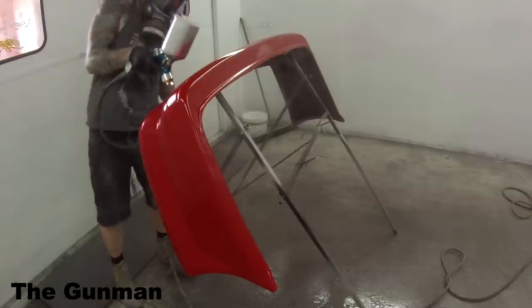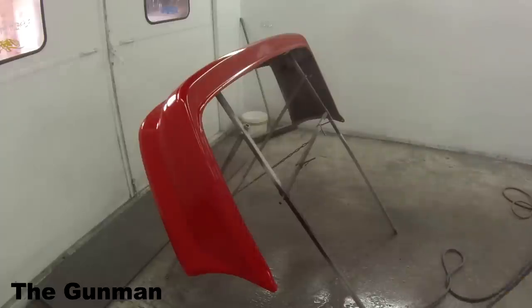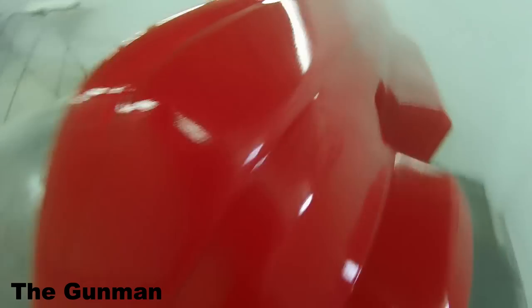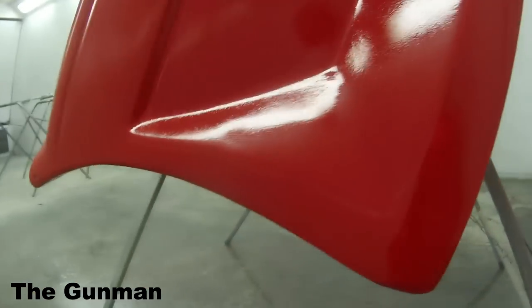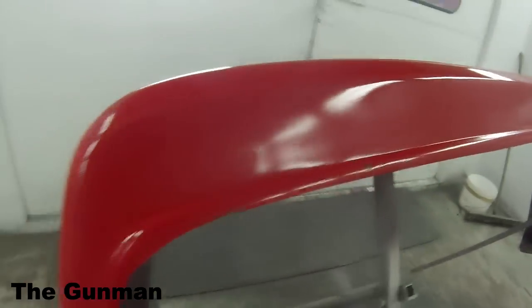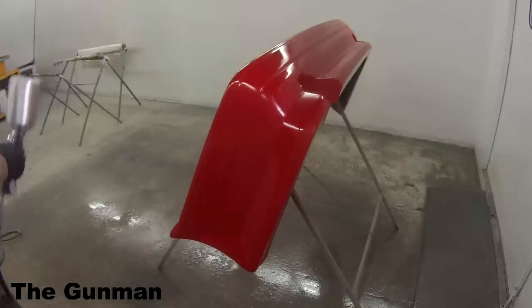The gun itself still has a little bit of a small fan on it. Those who saw the previous video — I wasn't too impressed with how this gun held up against the thicker primers. However, once I thinned it down, it opened the fan up a little and it was getting on nicer. It's doing basically the same thing with this VOC top coat, even with the 1.5mm. I would never use a 1.8mm for top coat colour — it's just too much. It seems to be going okay once I put a touch more thinners in it.